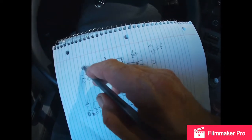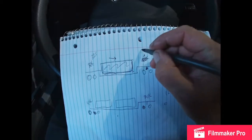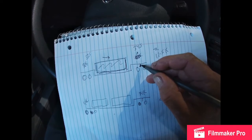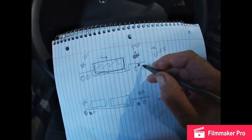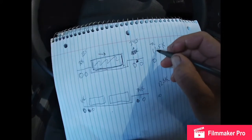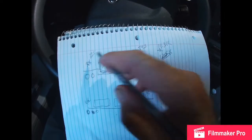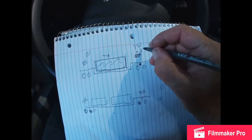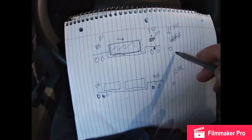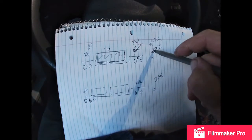But let's say I get this down to 33.5, but now here I'm 34.5. So what I'll do is move this. I can move 1 or 2 notches forward. I think last time I moved it, I got 510 pounds a notch. So we'll move one notch forward, then go back onto the scale and rescale. Now after I scale, I'm 11.3 and 33.7. I'm good to go. But if I end up overweight and I can't move it, they have to take glass off.